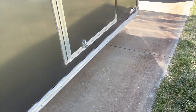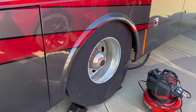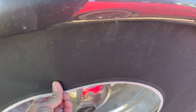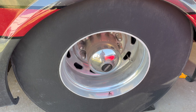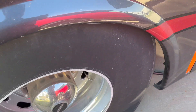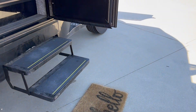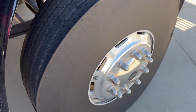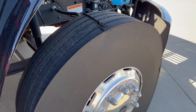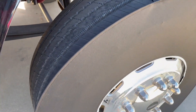We have these UV covers on the trailer as well as the motorhome. What we've been told is that since we don't drive this six or seven days a week, eleven hours a day, we'll never wear out the tread — these will age out in about five to seven years and just have to be replaced due to age. UV is the enemy of rubber, so these tires need UV protection. This style looks nice from a distance — some look like big brown bags, but this one just has three clips you slip over and attach. On windy days these would blow away without those clips.